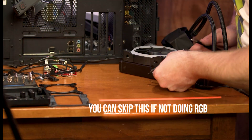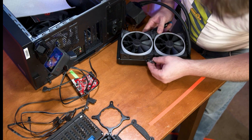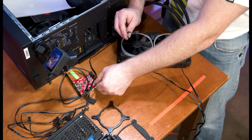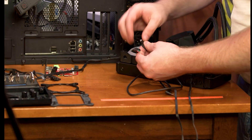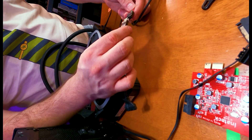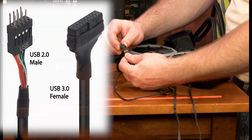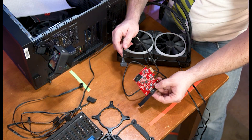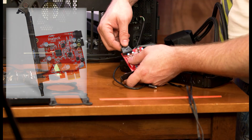Once we're done with the fans we're going to finish up the RGB. The first thing we're going to do is plug the in and out — this is for the lighting on the fan. You plug in the middle wire; if it feels like it's not going in, flip the wire around — it can be a little bit confusing. This is what's going to allow the NZXT fans and RGB to be controlled, because it's a USB 2.0 header. This is a USB 3.0 to 2.0 female-to-male adapter — I'll have all this stuff linked in the description. This PCIe card and USB adapter are not included, you'll need to purchase them separately.